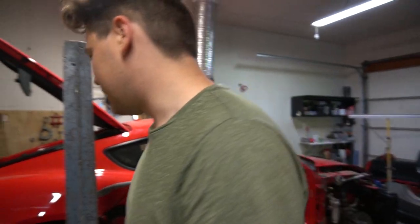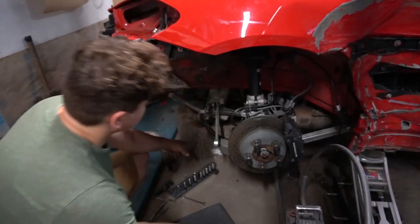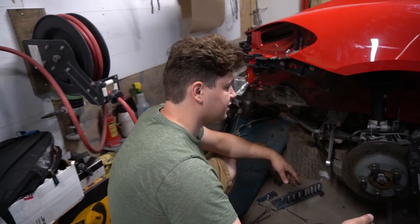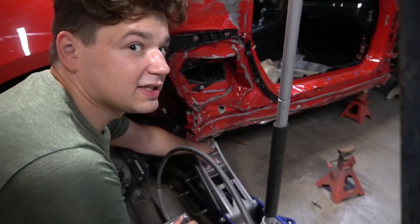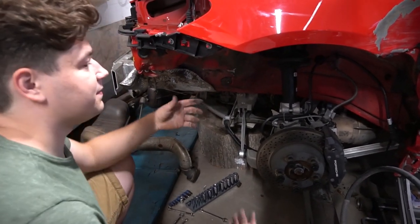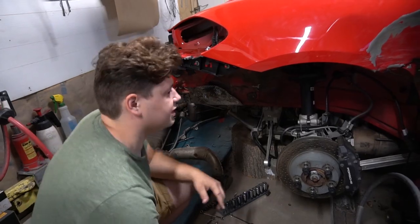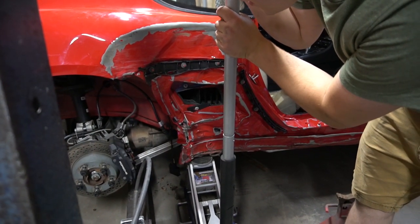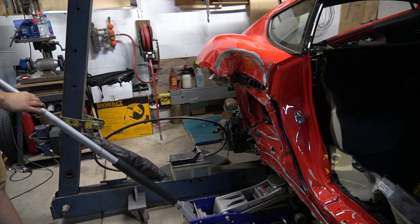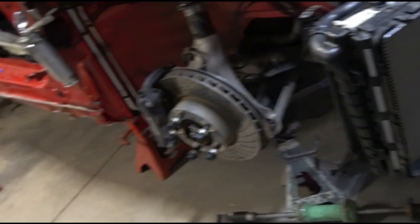In order for me to set everything up — I don't have a frame machine — I grabbed a big block, a big piece of wood, and I put it underneath the car. The reason why I'm doing that is because instead of the jack stands sitting right here where this jack is, this is exactly where I have to pull. So instead I put a big block here. That way if the car does shift an inch or two, it's not going to fall and destroy anything else — it'll stay on the block. Now it's standing on that subframe piece, so that's good.